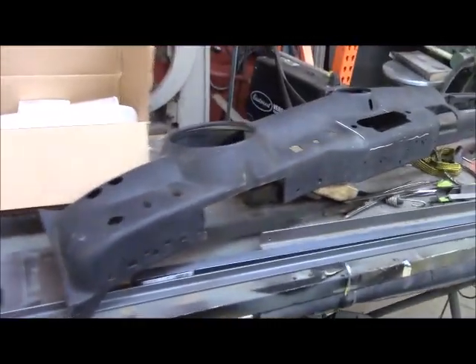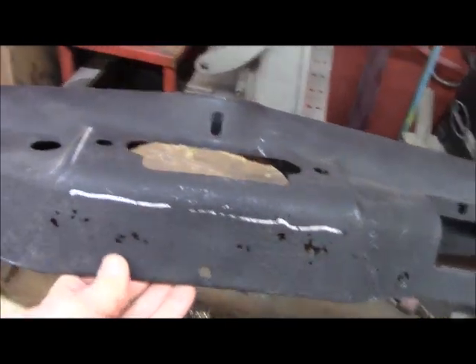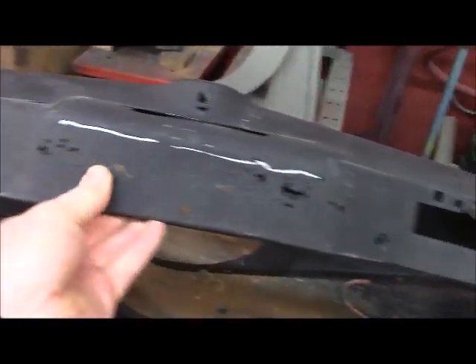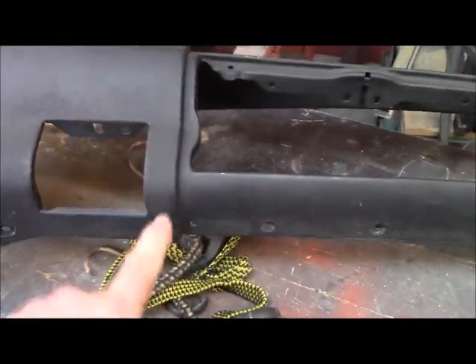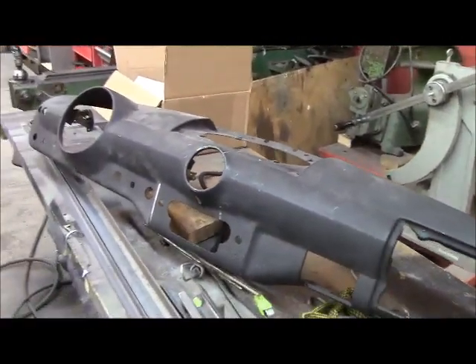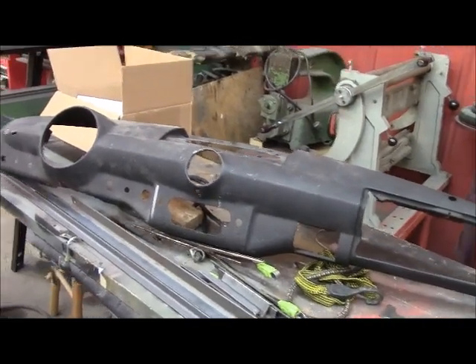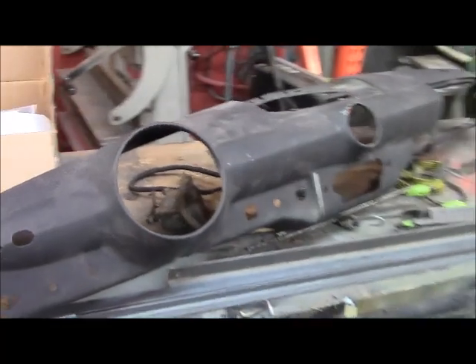I want to show you what your dash looks like. Here's your dash. You can kind of see even on the dash what I'm working with — your dash is just super thin. These dashes are very rare, hard to come by, but everywhere is thin pinholes and rust. That's what I've been fighting the whole time. It'd be sweet if that dash was in good shape and it'd just be epoxy, prime and paint, but it's not going to be that. So let's get back to work.